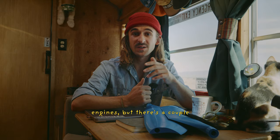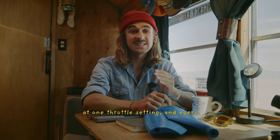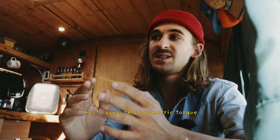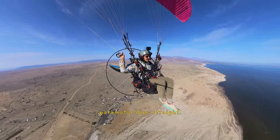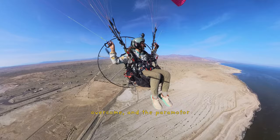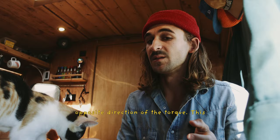The main drawback is that geometric torque compensation is fixed. So it works the best at one throttle setting and every other throttle setting it's not working as well as it should. In most cases, this geometric torque compensation is tuned for level flight, so when you're flying around not climbing or descending, the paramotor flies straight. But when you add more throttle, more torque is present, the torque compensation is overcome and the paramotor starts to turn left or right. And the contrary happens at idle — zero torque is being applied, so that offset is just turning you the opposite direction. This works pretty well for most cases, but there is another and in my opinion better way to do it.